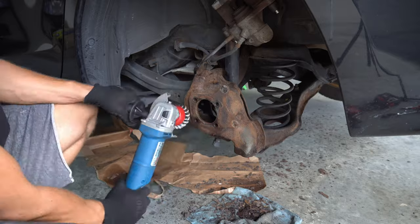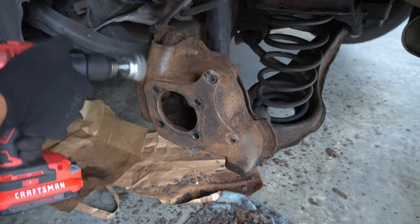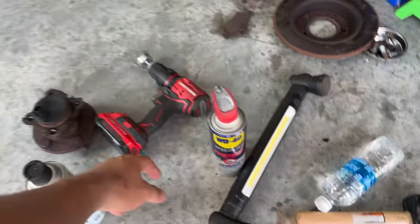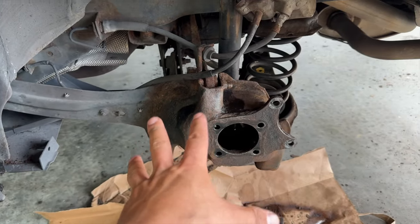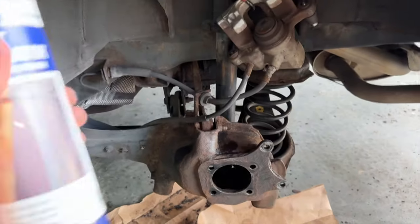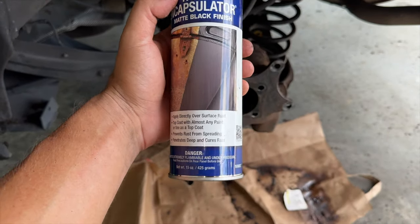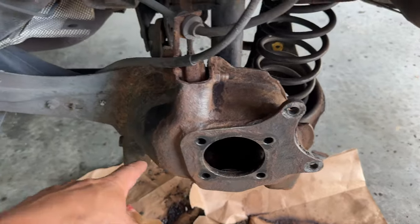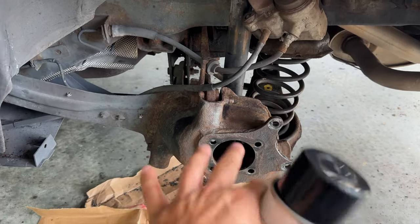Before putting on the new one, it's a good idea to clean off the mating surface — you want this to be as clean as possible. I used an angle grinder with a wire wheel as well as my drill. I finished cleaning the actual hub using some brake parts cleaner to clean off all the scale and rust, then for the heavy duty stuff I used my angle grinder. I'd be doing this car a disservice if I just left the bare metal like this because it will rust again. I'm now in Florida, but for all those people with Mazdas, pick up a rust encapsulator — it's about $30 a can but it's worth it. You apply it directly over surface rust and it prevents rust from spreading, penetrates deep, and cures fast. Once this brake cleaner dries, I'm going to spray this down with rust encapsulator to keep it from rusting again and make this a much easier job if I have to replace the bearing in the future.